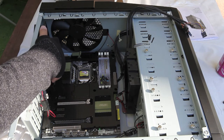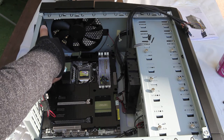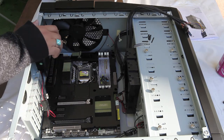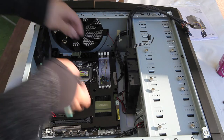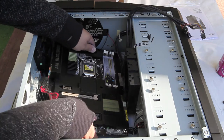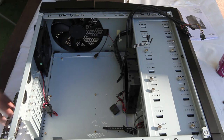One reason I'm doing this is because it's just a mid-tower case, not a full-tower case, so there's not a lot of room to maneuver inside here. I need to make sure that all my screws are in the right spot. You have to pick points where you're going to place your motherboard screws, and this is just way easier done without the processor and processor fan on top.